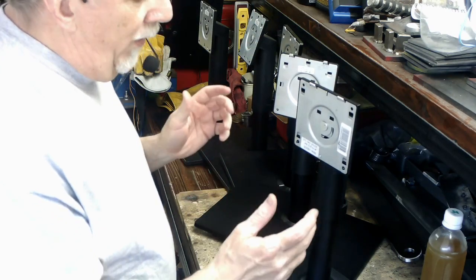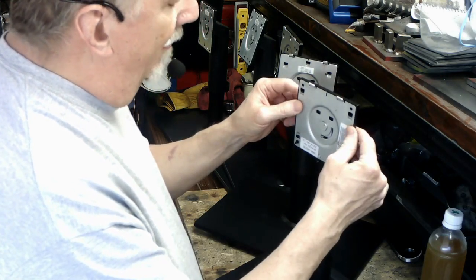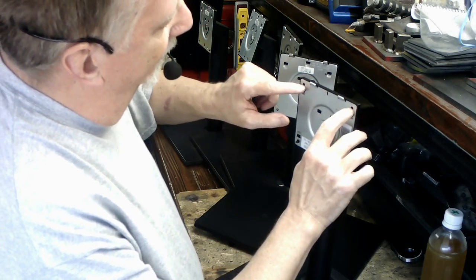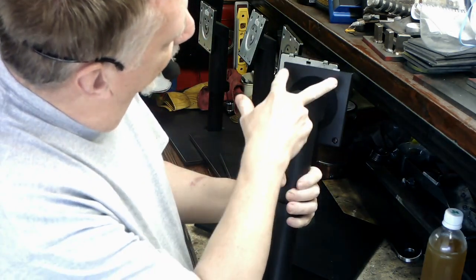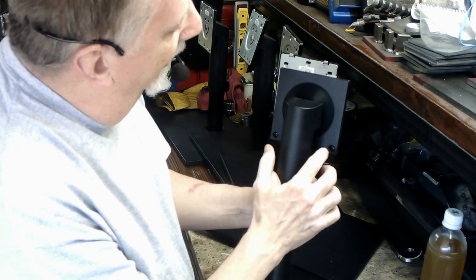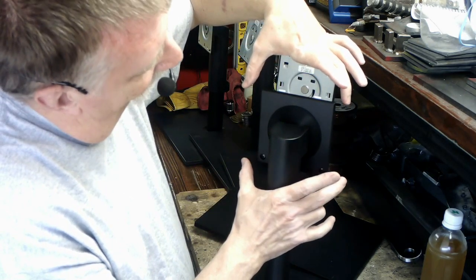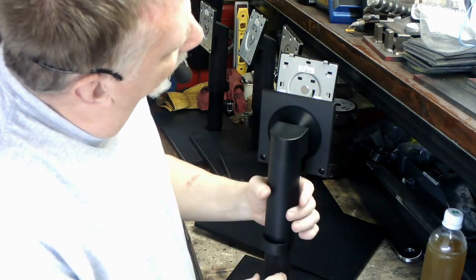Well, when looking at this particular style of monitor stand, I don't know, maybe over a year ago, I noticed that this one was actually, the metal plate was pre-drilled with holes so that, in principle, if you drilled it out, you could use it with any monitor because the monitors all have four screw holes. There are sometimes different sizes. Some are bigger, especially on the heavier monitors, but they always have the smaller four-hole pattern as well,